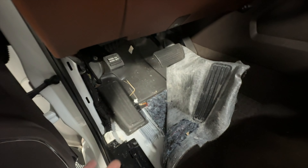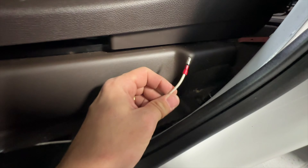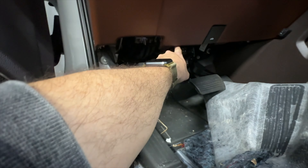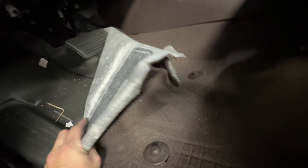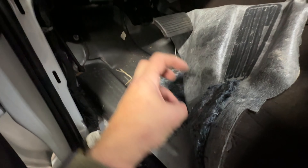One thing I missed — not missed, I did it wrong, and I want to give you guys a warning. The white wire — you cannot pull it over there. You've got to pull the carpet and bring it down here because the wire is just too short to go over. That's about how much you need. Don't put it crossing the OBD port — just straight. That's what it's coming off, so the carpet's going to cover it. You'll have enough wire for both sides.